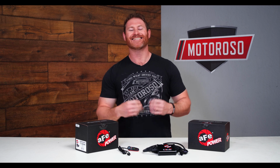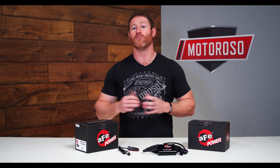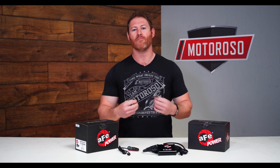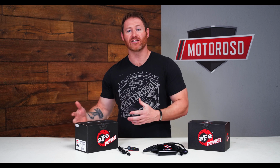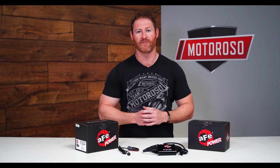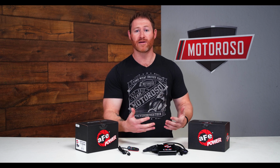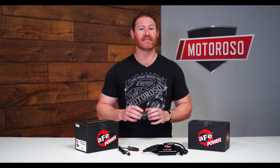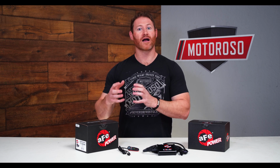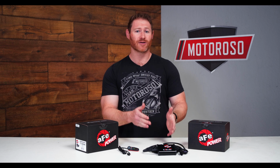And what this does is subtly intervene in the engine control system to push the boost a little bit further, giving you more power, more torque, and more efficiency. And a piggyback tuner like this does actually have a couple of advantages over ECU tuning itself. As I mentioned, it's just a subtle intervention, and it's not going to imprint or leave any sort of footprint on the ECU, so it's not detectable, and that means it's not going to void your warranty, and it's also not going to cause you any issues with smog down the road. It also makes it a super easy installation.